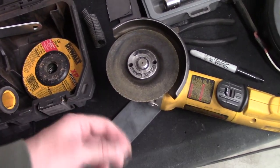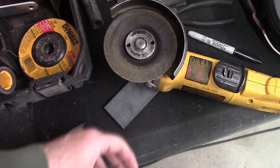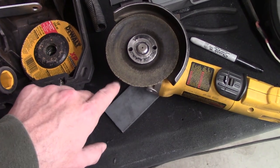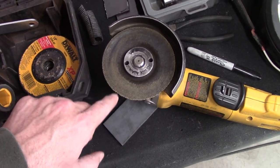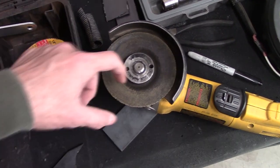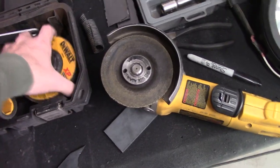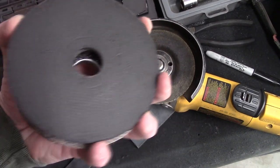That stuff explodes, and you can end up with a penetration wound. A chunk of this sticking in your flesh would not be fun. Not a good ER trip. But that's not bad to me. Others might throw it away right there, but if the abrasive chunks out or cracks, toss the wheel. Otherwise, I run it down until I have nothing left. Stuff's expensive anyway. Other versions are straight up flat, so you can go even farther. Same thing, quarter inch discs.